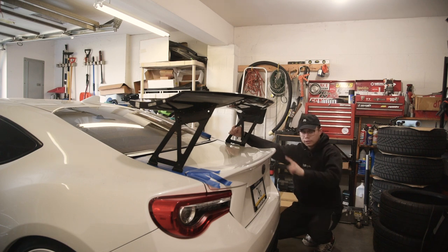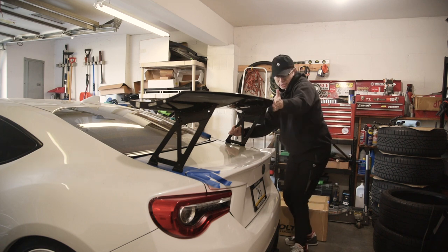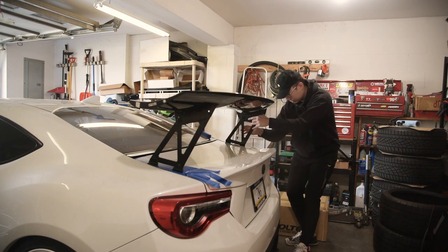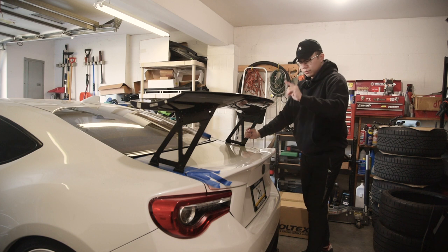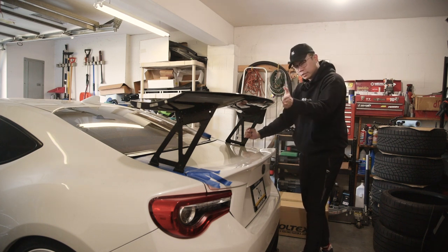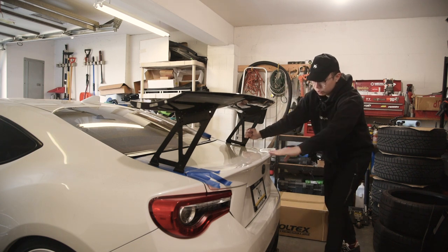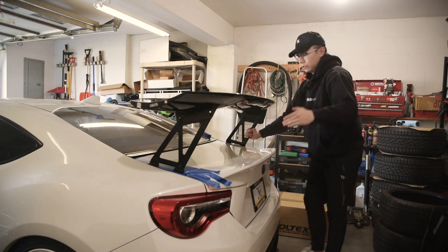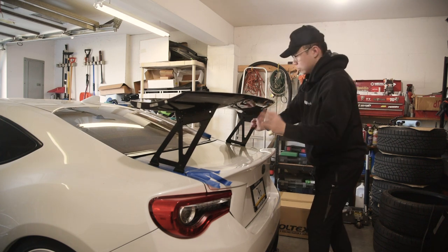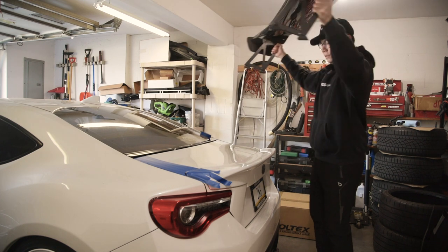I think it still looks okay. I want to keep the TRD lip because without it it looks kind of too round. The rear deck foil lines up with the TRD pretty closely. Right here in this position, the back of the foil kind of lines up with the TRD lip — I would rather have it stick out a little bit more, but this is where we're at without trimming the lip at all. The height, 275mm tall — which is about 10 inches — is pretty much at the roof line of the car. It fits very nicely and the 1600mm wide width kind of matches the rear quarter panel. It's definitely proportionate to the car, which is what I was going for.